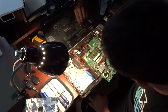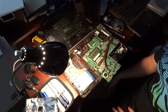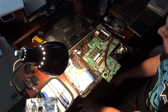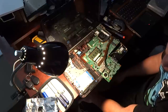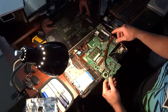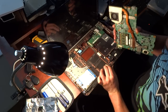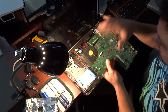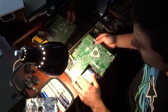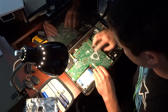Keep in mind a lot of people say this is a temporary fix — I wouldn't quite disagree with them. But at the same time, I did one for my mom, she had an HP, it was a smaller 14-inch HP, the DV2000 series. I did that almost 4 years ago to this day and it's still running perfectly with absolutely no problems. I reflowed it the same way I did this. And sometimes you do alright, and some of them I guess the solder joints actually run out of solder and it can't really be put back.